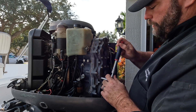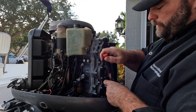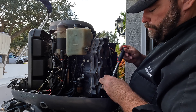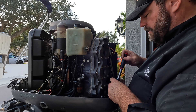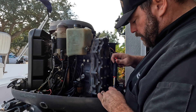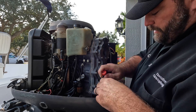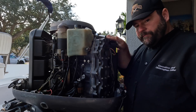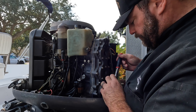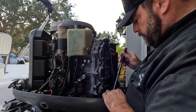When you put these back together, there is a torque pattern with a torque spec sheet and you will need a torque wrench so they're at the proper foot-pounds or inch-pounds as specified by the manufacturer. The bolts are numbered, so when you go back with your manual or your online torque spec sheet, you have a pattern in which you've got to torque these back down so that the gasket on the cylinder head and water jacket are done correctly. I've got a deep well 10 millimeter on this water jacket and I need a shallow well for some bolts.